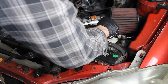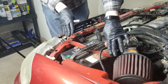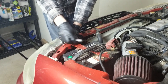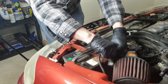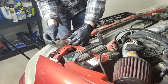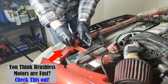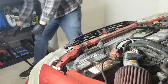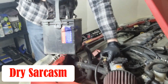Now I have all the battery connectors off. I'll keep the positive shoved in a corner so it doesn't cause issues. Next I'm going to pull both fasteners off so I can remove the battery mount and pull the battery out. One has a long bolt and an anchor bar on the bottom end. Once the mount is off, I'll pull the battery straight up and out and place it to the side — we won't need it for a while.